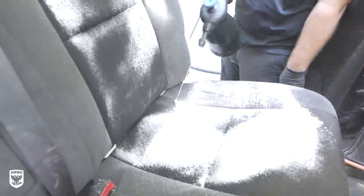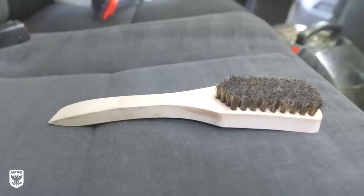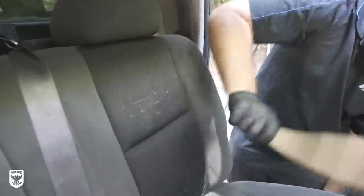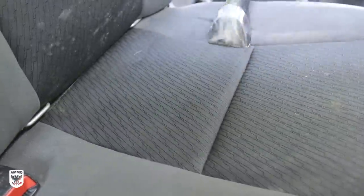With the headliner and the doors done, next up were the seats. The safest way to clean the fabric is the tamping method. Notice the brush has a slight angle and very short bristles. Hitting or tamping disperses the loosened soil into the shag cleaner, then it's either absorbed with a towel or, in our case, it's extracted.